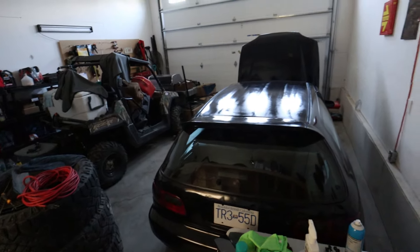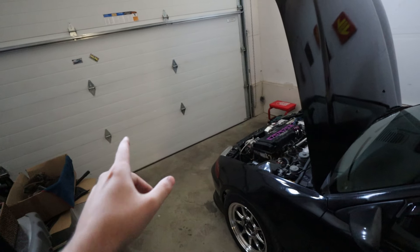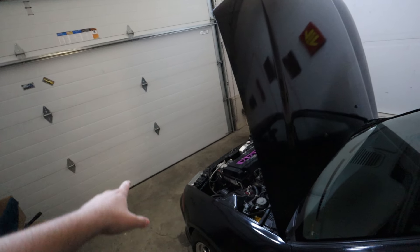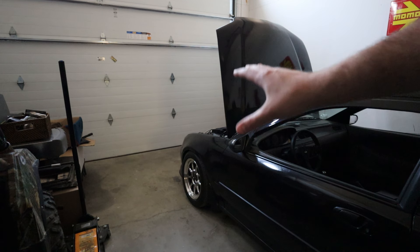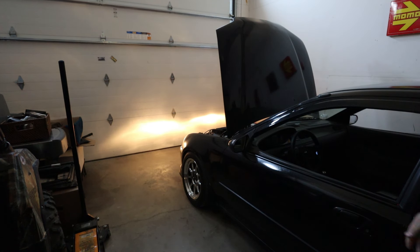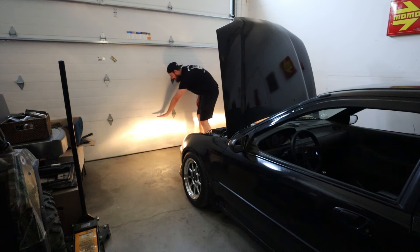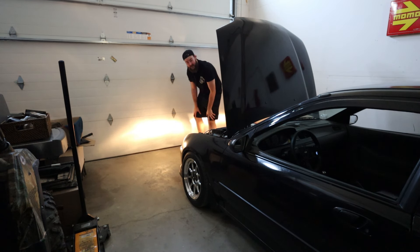It's a little darker in here — still a bit bright — but you guys will get the gist. I'm going to set the camera up and check out the projection. I'm also going to put green tape on the door to mark where the projection line is, so we have a solid comparison. Test number one with the OEM halogen bulbs in the OEM headlight housing. Honestly, very poor performance. The top of the headlights barely makes it close to the top of the headlight housing — we're basically only illuminating what's below us. I'm going to tape and label it 'OEM halogen,' then we'll get to the install and do the direct comparison.